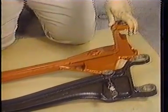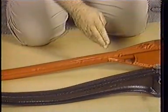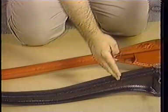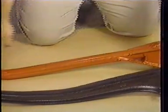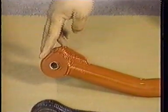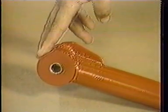Let's talk about the tubular design construction that we talked about earlier. This affords a lighter beam, which gives us less unsprung weight than does the factory beam. Down here, we have the Rancho DuraCrush urethane bushing. Gives long life and resists elongation.